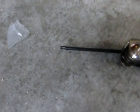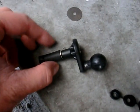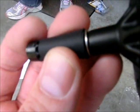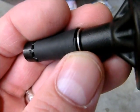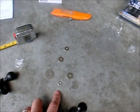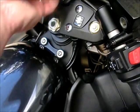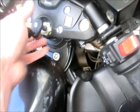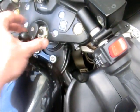Okay, so I needed another tool. I grabbed it. Here's what we got. Out of all these nuts, etc., I basically have this 1-inch piece. It has me put this nut down here along with this grip washer. Now, you see this nut between this and the ball? They give you a selection of washers, but you have to use the biggest washer that's actually going to fit down into the stem hole, because this entire assembly is going into the hole, if that makes sense.